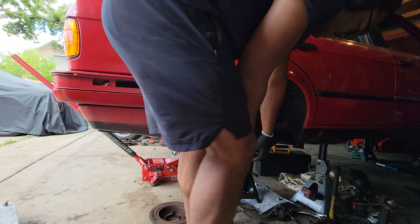Once I broke that off I took a hammer and just beat this edge so it would kind of turn back and forth and eventually it just loosens itself. I was thinking it was going to have this piece still stuck in there like it does on the other side — and on that one the whole bushing came off but that piece is still stuck up in the dowel. Based on other videos I've seen, what they do is drill it out and chisel it out piece by piece. I also used a sawzall, sawed a cut in there, did one on each side, then used a chisel and hammer to just tear into it, and it popped off.